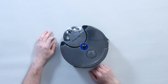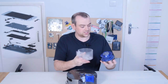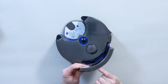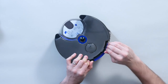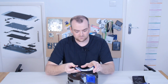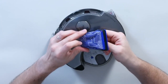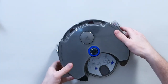Before we get too into anything, there's obviously some self-assembly we can do. We've got the bin, which is obviously a bagless cyclone model coming from Dyson. And there's a pair of filters on this as well. This one is an outlet filter — once it's been through the vacuum cleaner, the air gets pushed through this. And this pleated filter is called a panel filter, which is quite common in the industry. You find them with air handling units. You can sort of shake the dust out, and that's recommended on a monthly routine. Around the front we also have a bag filter. This is a washable bag filter — it's not a consumable. You can wash it at home and keep going. That's a really nice thing.